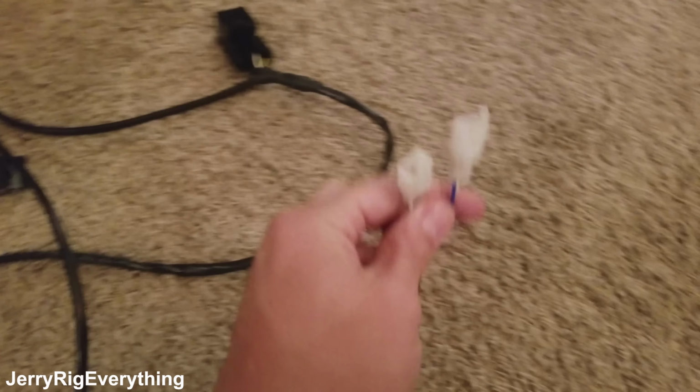Okay, so Braxton has adjusted the ends of the wires just a little bit, so tell me what's going on here. So we have a fuse tap right here. This car actually has a spot for seat heaters. If it didn't have a fuse position for the seat heaters, we'd just use like a cigarette outlet or something like that. But because it already has that fuse, we're just gonna use an add-a-fuse. It's gonna connect to the power wire. We're gonna use a 10-amp fuse to keep that safe.